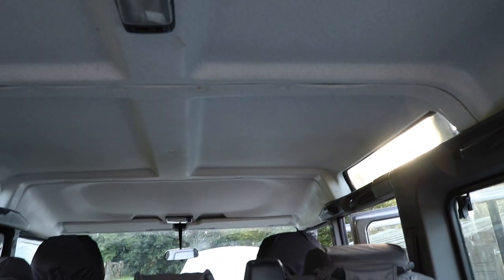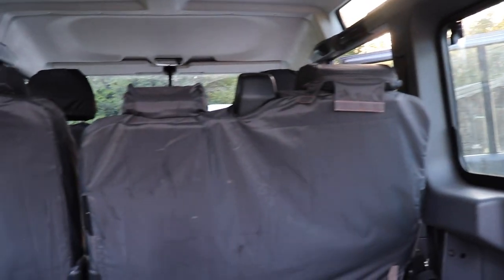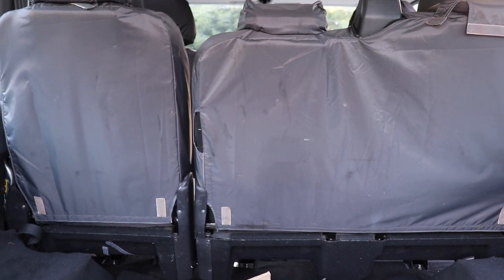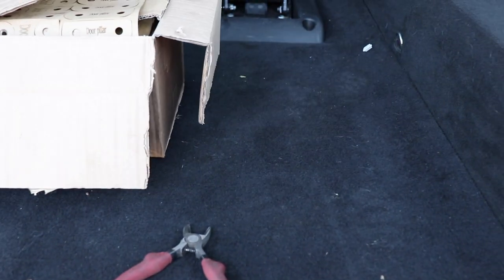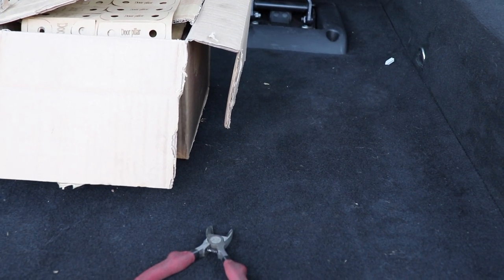Moving to the inside - I've spent the last few weeks soundproofing the Land Rover, which is notoriously noisy. I've basically stripped out all the seating, which is actually quite easy to do. Everything unbolts - it's just like a Meccano set. All these roof panels are not that difficult to remove. You've got what they call fir tree clips all around the roof panels, and you just simply snip them off with a pair of side cutters. Don't try to remove them - they end up bending and breaking. You can order more off eBay, they're not that expensive.